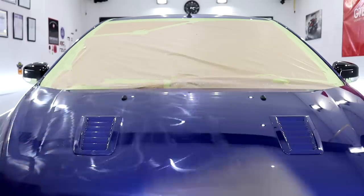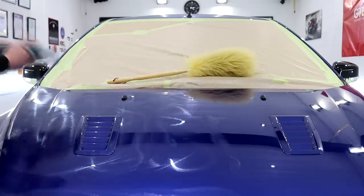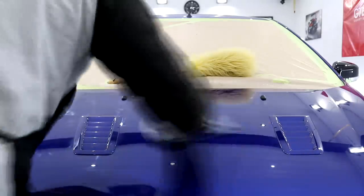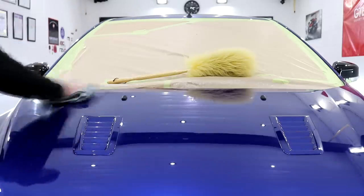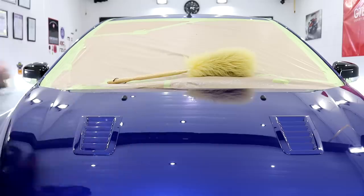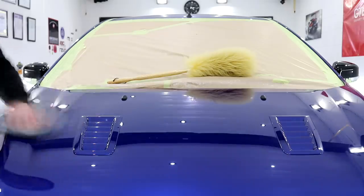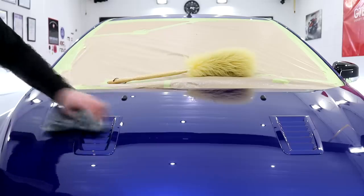You can do the crosshatch pattern with a relatively slow arm speed, where you go vertical twice and horizontal twice whilst keeping your working section to a manageable size. I do use this technique across all applicable panels, with the only exception of if the panel is too small. I would complete this crosshatch type pattern, but I don't religiously go horizontal, then vertical, then horizontal again, and vertical for the final time in that exact order.